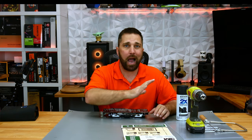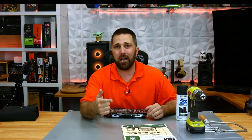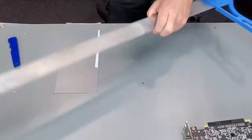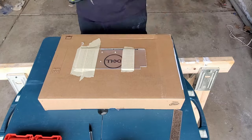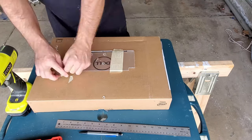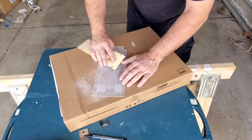I'm not exactly sure how much all this cost — I just grabbed it out of my garage — but it's definitely cheaper than ordering a custom made backplate for this GPU. Since most of the work on this I'll be doing in my garage, I'll explain how I'm going to accomplish this and then edit in a montage of the process. First, I'll measure out or trace out the shape and size of the backplate. I'll use the acrylic knife to score and then snap off the acrylic. I'll use the coping saw to cut out the small notch where the power connector is. I'll also mark where my GPU mounting screws are located, drill out those locations, and drill out a pattern of holes as a simple design element. Then I'll use the sandpaper to finish the edges of the plate as well as prep or rough up the surface so the paint will adhere.